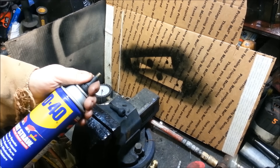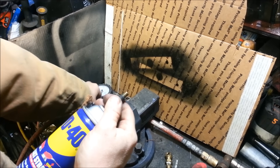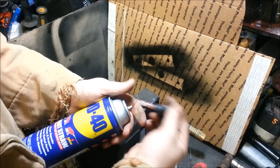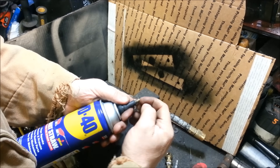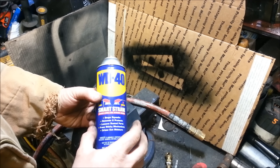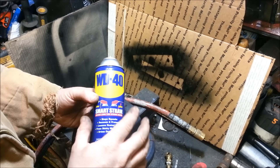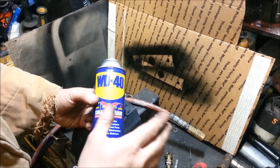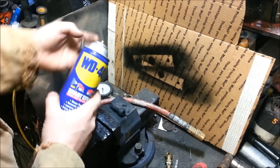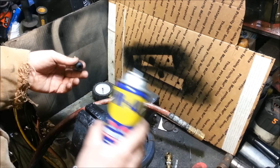You're going to hook your tire valve to it, whether it be this style, this style, whatever style you have, or even your bike pump. If you've got a bike pump, you probably have to use two people. We're going to put pressure in here. A brand new can had about 90 PSI in it. WD says they put 95 to 105 PSI in here at 70 degrees. Of course, the warmer it is, the higher the pressure gets in there. So if you put in 100 PSI, or whatever most standard compressors do at 90 PSI, you'll be safe.